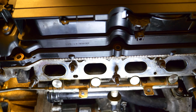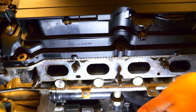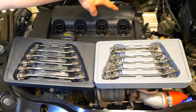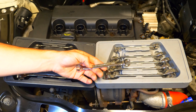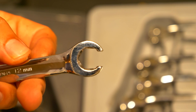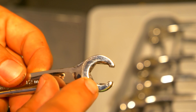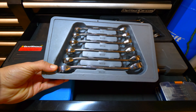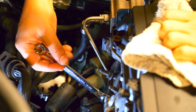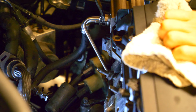We're going to begin by removing some of the fuel components such as the fuel pressure regulator, the fuel injector, and the fuel rail. In order to remove those we're going to need to disconnect the fuel line on the backside of the motor that connects up to the high pressure fuel pump. To remove the nut safely without stripping it you're going to need a flare nut wrench that grabs on five of the six sides of the nut. For this car we're going to be using the 12 millimeter — you can find this entire kit in the description box; it's a GearWrench kit and it works great. To remove this fuel line there are going to be two nuts — one attached on the fuel rail and the other on the fuel pump. Put a rag underneath to catch any excess gasoline that's going to come out once we take the nut off.